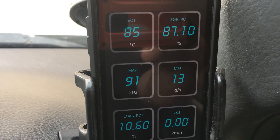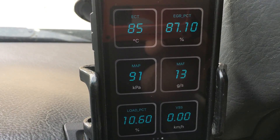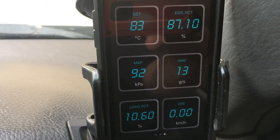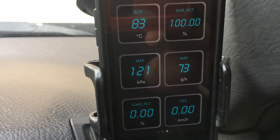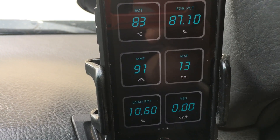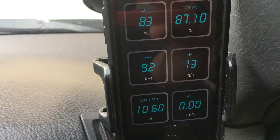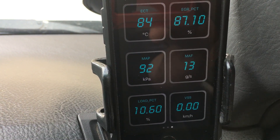We've got EGR percentage. At the moment the EGR valve is 87% open. When we get into the gas — I'll just give it a quick stab — notice when we gas it the EGR position goes to zero. That means it's closed, it's getting all cold filtered air, because that's what the engine works best on. Right now 87% open — just because it's that percentage open, it doesn't tell you how much it's getting, but I can tell you normally they'd be getting a whole gut full of crap, which we've discussed in other videos.